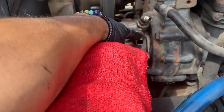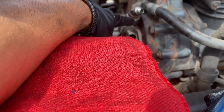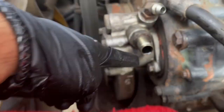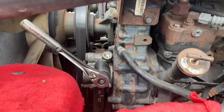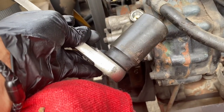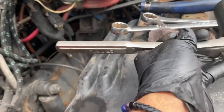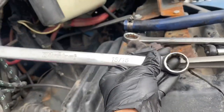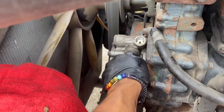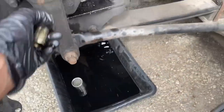The high pressure hose right here — that one's a 22 millimeter. I'm removing the hoses, and then I'll probably remove that fitting from there since I don't have a vise on my truck. This one was also a 22 mil, and I had to use a one-and-a-quarter inch. It was kind of stuck in there so I used this one inside as a cheater bar, but I got it out. More oil is coming out but I've got my drain pan on the bottom.